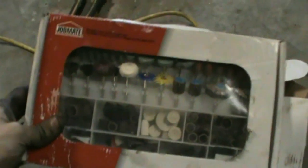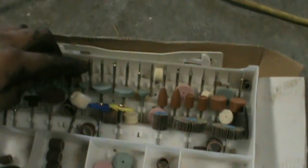Just to show you some of the tools I use — I use these little electric die grinder things with an extension wand so you can get down inside the runners. I always buy these when they're on sale for like 10 or 15 bucks. I've got a couple of the Mastercraft sets so I just stock up on them. Pretty much every little grinding stone you need to do it is in there. These are also used for glass etching — you get quite a bit of good little parts for like 10 or 15 bucks, so you can't really complain. Got it all ready to go with a cylinder-style grinding stone — just going to start going around and taking down this edge a bit to get it shaped.